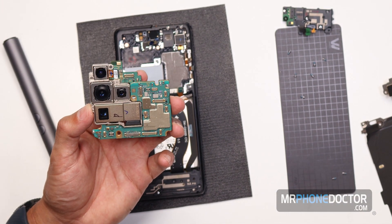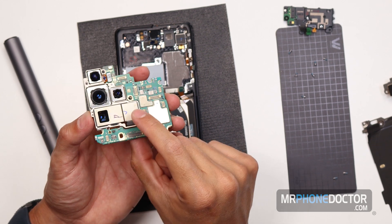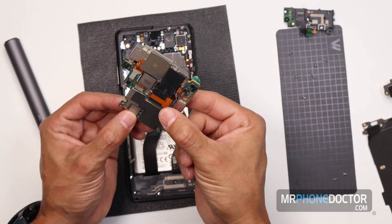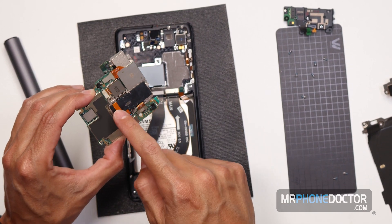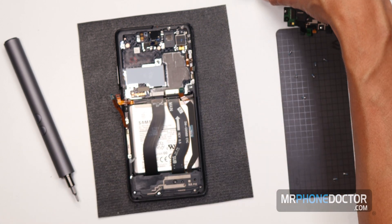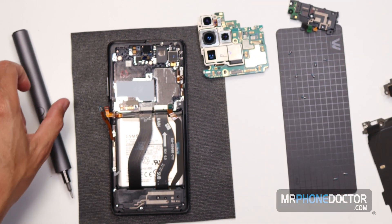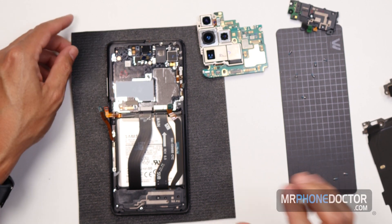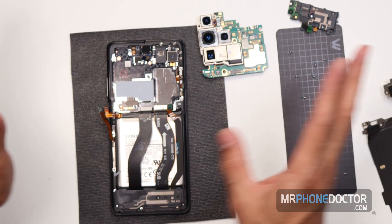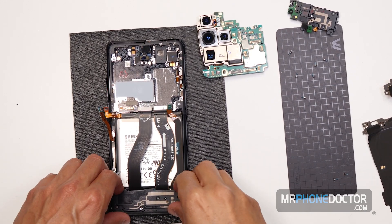And of course, you can see all the nice cameras — it's got three, four cameras. You have your wide angle, super space zoom — this is your space zoom here. And of course, if you guys did need to replace this camera, you can. The flexes are all back here, so it's got three flexes and you can detach and replace this component. It's really nice that they make that replaceable very easily. I haven't heard any rumors of Samsung trying to serialize them and make the cameras not work. I know on the iPhone 12 when it first launched, you were able to switch the boards out and the cameras would stop working — that's a big issue, and that is why I'm a big fan of the right to repair. I'm really hoping things move forward with that. The FTC just signed a legal action, so we'll see how that moves along.